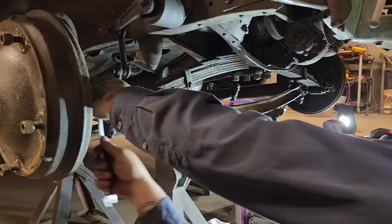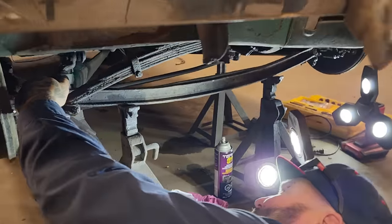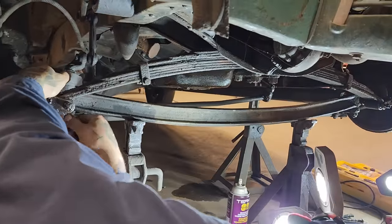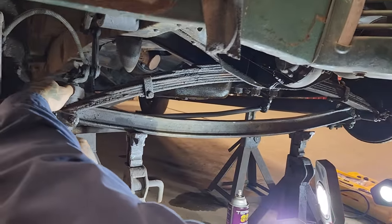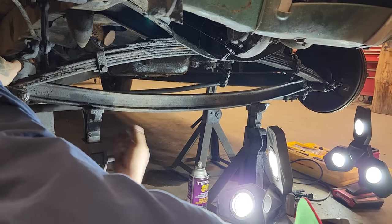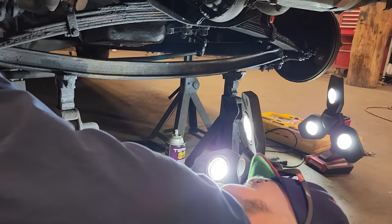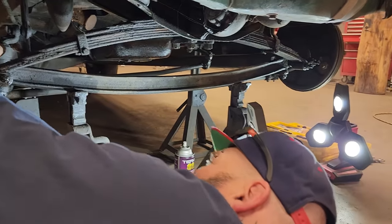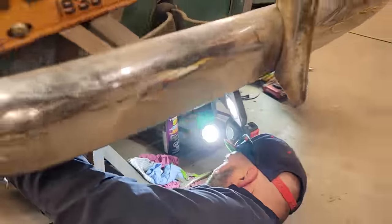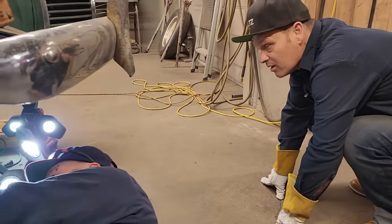He's got the frame up on jack stands, and he's got the front end cross member up on jack stands, so if you take the spring out, nothing's going to drop or fall. You'll be able to just pull it out. Is that what you're thinking? Yeah, these two jack stands will come back out when I put the jack under here and let a little pressure off the spring, and then set them on the stand after you take the U-bolts out. All right on. So there's some wrenching to go on there. You feel safe? Oh, yeah. Awesome. We'll check in on you every so often.